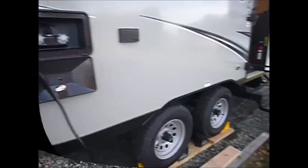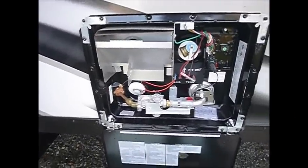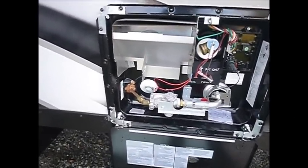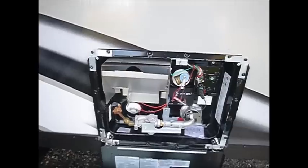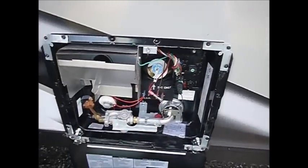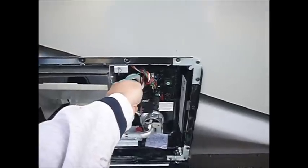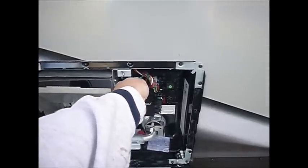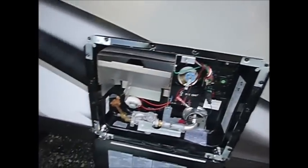Turn off the air compressor. You may hear some gurgling at the water heater — remember this is just a drain and there might be a little water there, but the manual says not to worry because there's enough expansion. There's pressure in the system, so we can relieve some of that pressure here. And there we go — that let the rest of the pressure out.